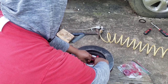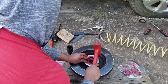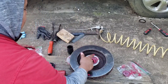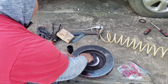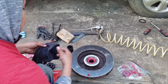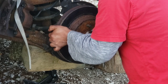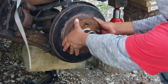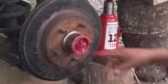Make sure it's packed perfectly. Now I'm going to get my hands dirty — no gloves for this part. Make sure the seal is clean and place it in slowly. Be very careful using a hammer — make sure everything is clean. It's very hard to make a video when you're doing this kind of messy job. After cleaning everything, I'll put it in there and stuff the outside completely with grease. Now it's ready to slide back into the spindle — be careful.